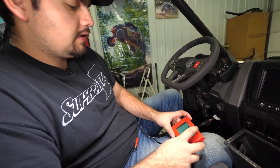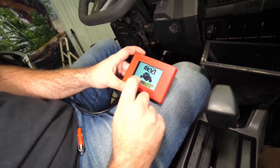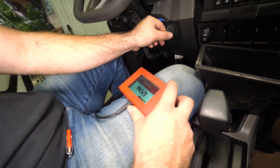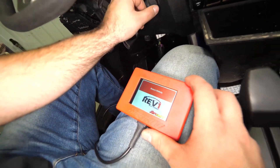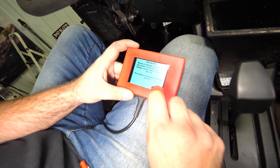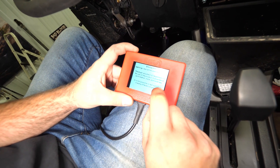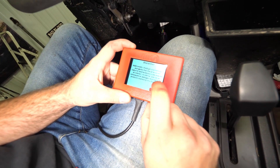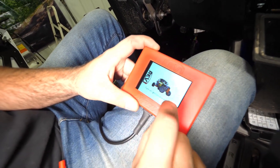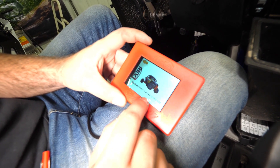We're just gonna follow the instructions. The touch screen needs to be calibrated, so we're gonna touch the screen and then touch all the black dots. We're gonna detect the vehicle — go ahead and turn the key on two positions. Everything should be turning on, but we don't want to fire the machine up. We're gonna go through and read the disclaimers, accept them, confirm ignition is on, and press OK. Success — unit is licensed to this ATV.